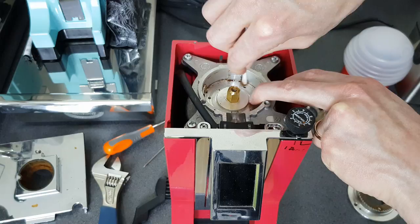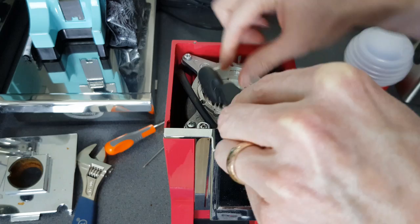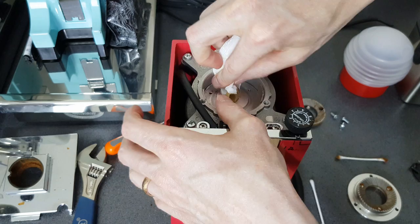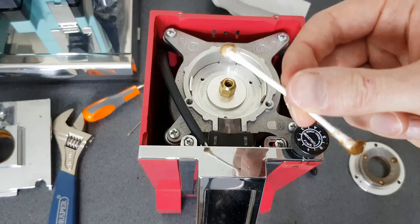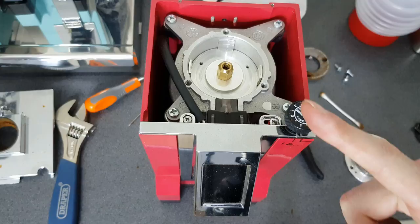Don't forget the middle here - again a skewer is one of the best things to help with that. Going around the edge, you may need to use the wrench again just to hold it in place. Just go around cleaning - it's basically loosening the coffee grounds because they get stuck around these edges, and you'll see very quickly you're cleaning up pretty well. You can also use a kitchen towel to rub around the edges to pick up bits you can't get to with anything else. Then I'm going to move on to cleaning the burrs, but I'll come back to this chute - we've got to make sure that's clean too.